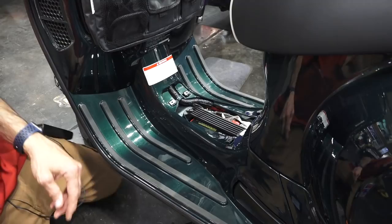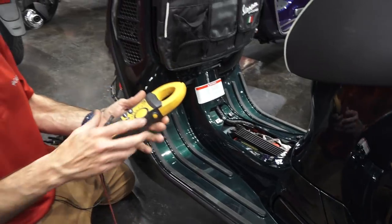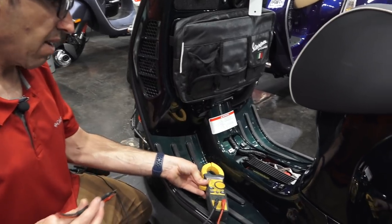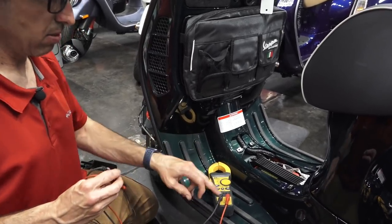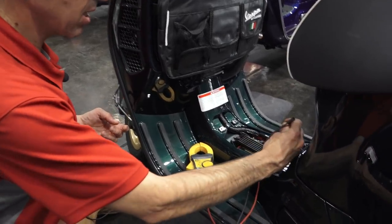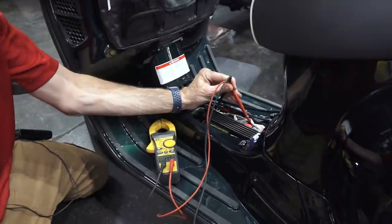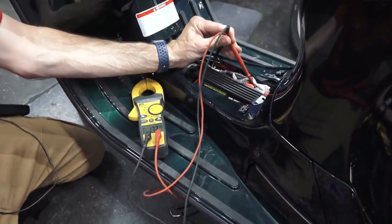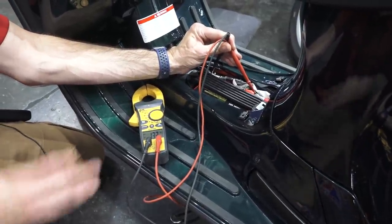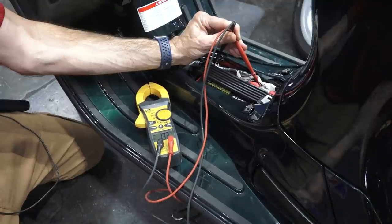Before putting the cover on, it's always handy to have a voltmeter. If you have an older GTS with a charging problem where it's overcharging the battery, you may end up ruining your battery. Set this to volts — if your meter doesn't do auto-ranging, set it to the 20V DC range. Put the two terminals across the battery and you can see it's sitting at 13.2 volts, which is the standard floating voltage — much higher than a lead acid battery. A fully charged lead acid would be about 12.8V; these are at 13.2, which is about 70% charge, or even higher at 100%.